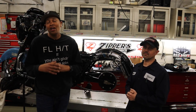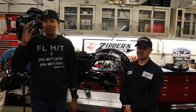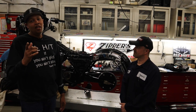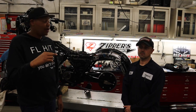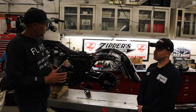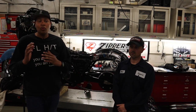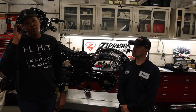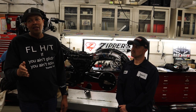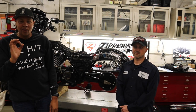If he had done it repeatedly, the belt would not have lasted. I see belts come off most often at bike events and red lights when people rev it up and dump the clutch — the belt just comes right off and they're going nowhere. For those who don't know, Harley-Davidson's touring bikes have been running belts since the 90s. This motorcycle came with a belt and I had no problems, but I've always been launching it hard with that thought in the back of my mind.